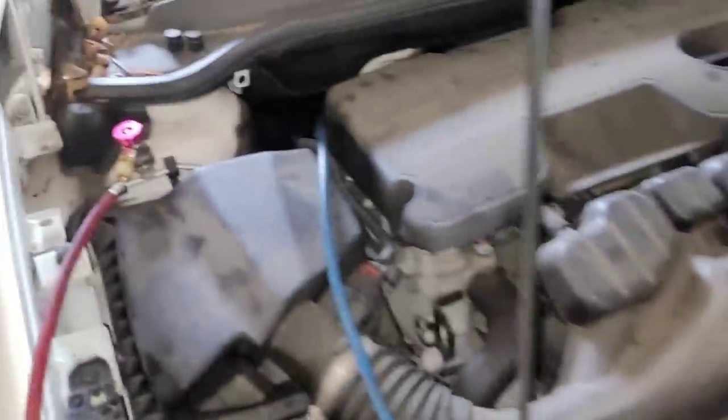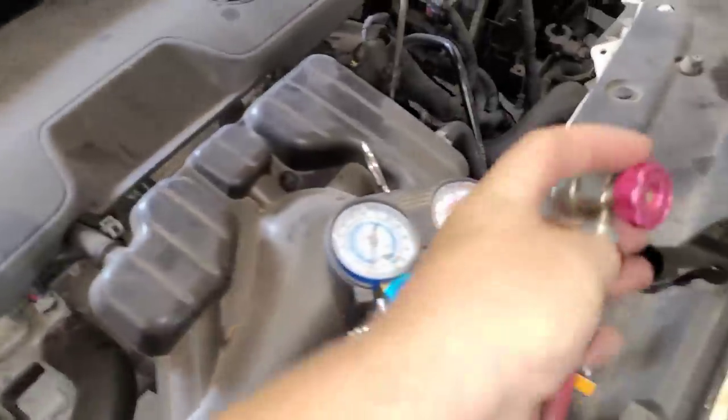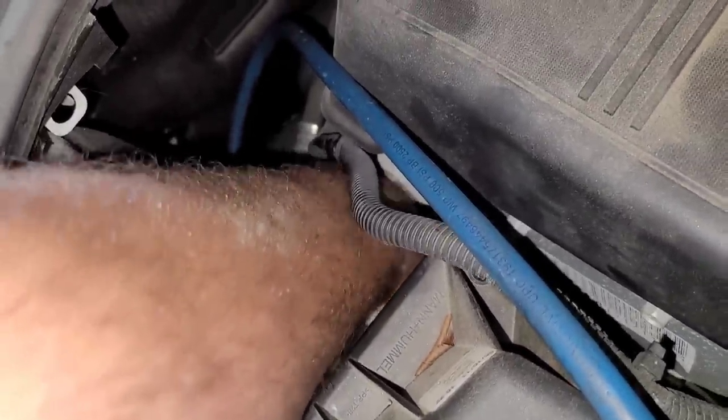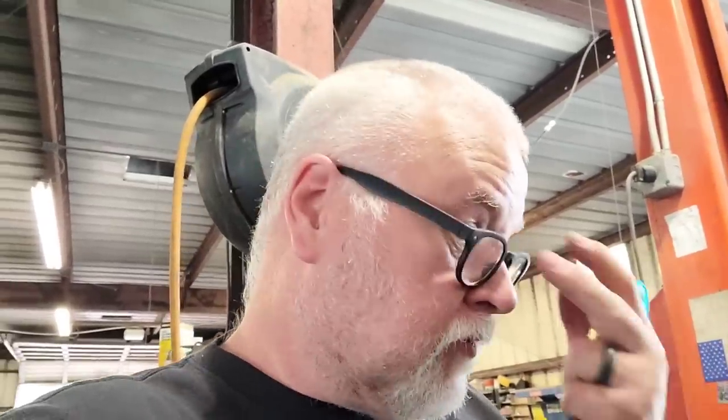The system's recovered. I just put it into a vacuum. I'm going to show all this, disconnect it, put it up in the air, and pull the compressor off. I always like to put it into a little bit of a vacuum, because a lot of times on an AC system you'll get a captured spot of refrigerant. All of a sudden you pull off a line, you swear it's completely empty, and then you get freon coming out. I'd rather have that than get shot in the face with actual freon — it can blind you. Something to be mindful of.